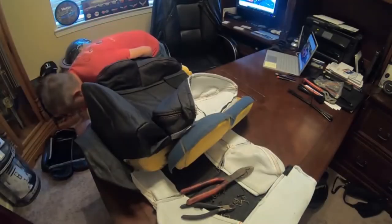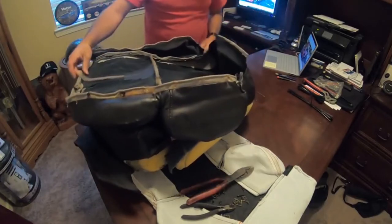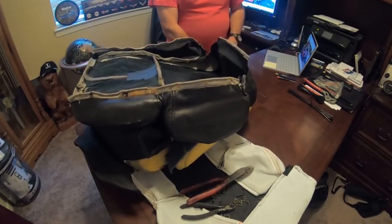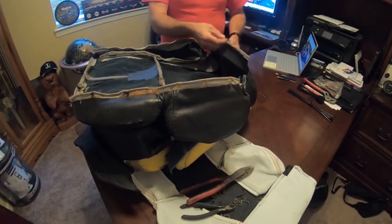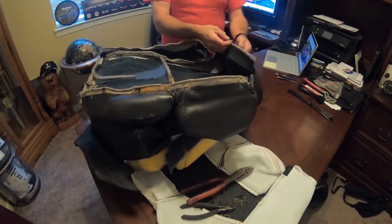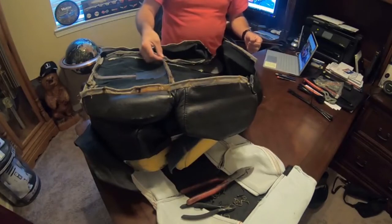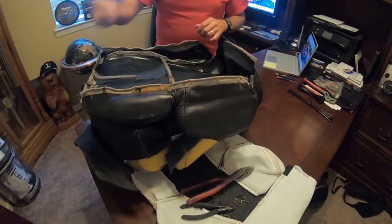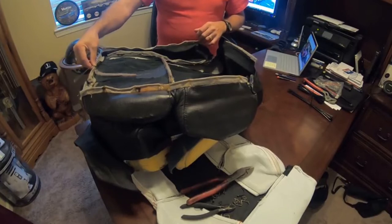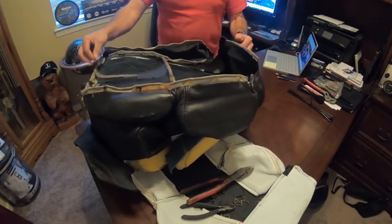Like that. One thing I did here before I pulled the old cover and threw it off to the side was, and again, like in the back seats, there's these little rods. There is a short one up in the very front part of the cover, and then another one that's a little bit longer, which I think I showed you earlier, in the middle. And then we have one in the very back of the seat also. That gets us where the hog rings have something to hook to pull all these four corners down.